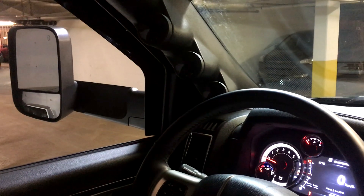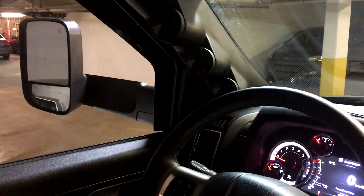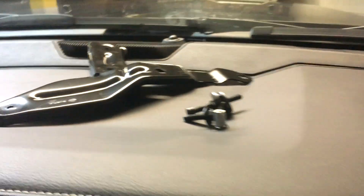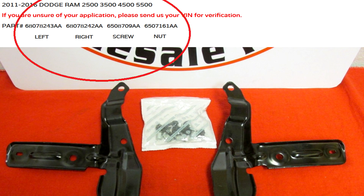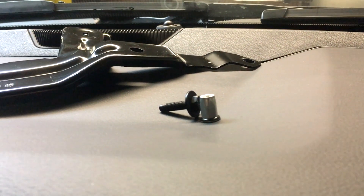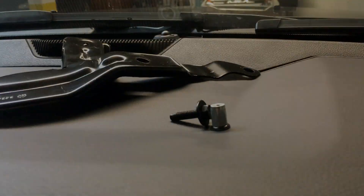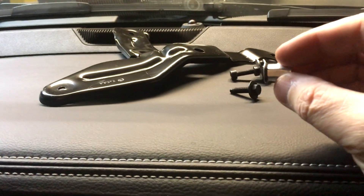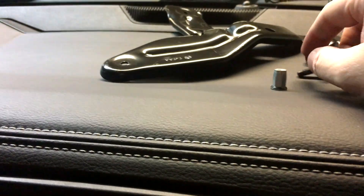When I was doing my research there were only a couple of videos on YouTube showing the installation of tow mirrors — none of them were power folding, and none used the support brackets. I'm going to use the Mopar support brackets, Mopar rivnuts and screws. This can all be done with basic hand tools, a socket set, Loctite, and a flashlight. You will need a rivnut tool, and I'll link a video explaining those in the description below.